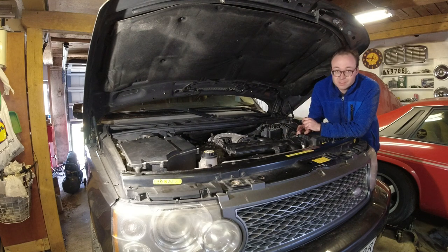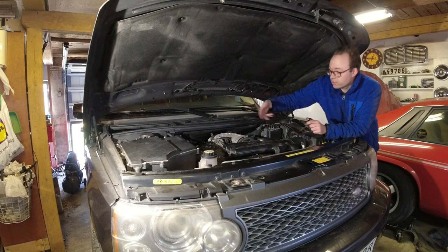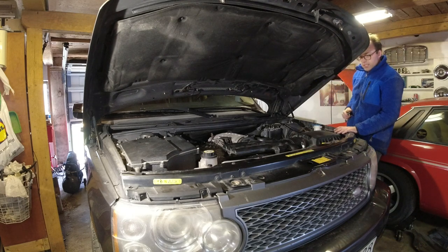Hooked up the battery. So let's see if this thing fires up, and then I'm gonna quickly start adding coolant because we should initially just start pumping everything around. We'll put the heat on so that everything circulates, and I'm gonna leave one of the doors on the car open, that deactivates the air suspension so it doesn't try to pump up and hit the ceiling. So fingers crossed everything goes well and I haven't forgotten anything and that there are no leaks.